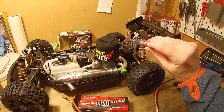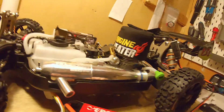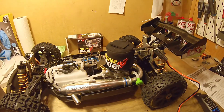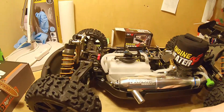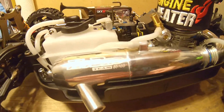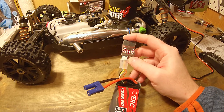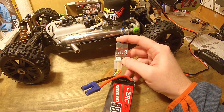Now I'm just going to stop it here — hold for 3 seconds, there it's off. Disconnect the battery. Just measuring the power of the battery: when I started it was 12 volts exactly — it wasn't fully charged. Now it's 11.7 volts, so it drained 0.3 volts from this battery. That's alright.